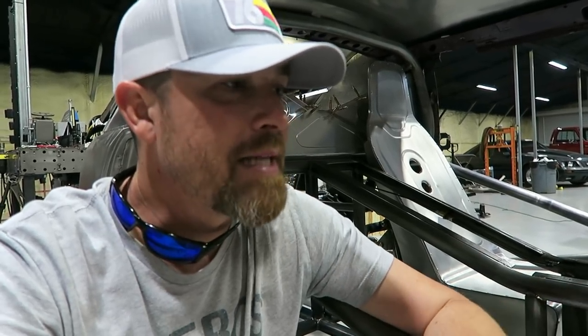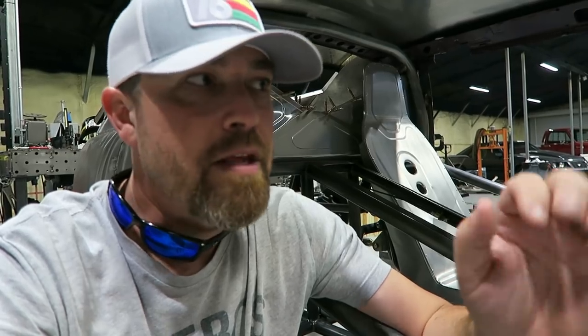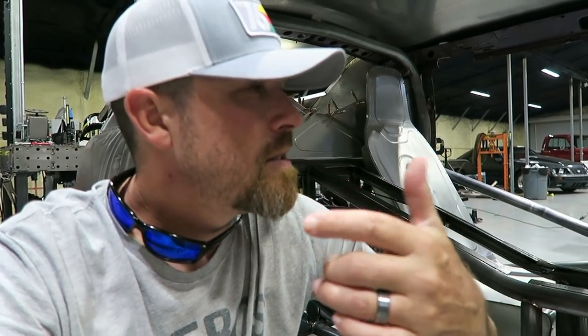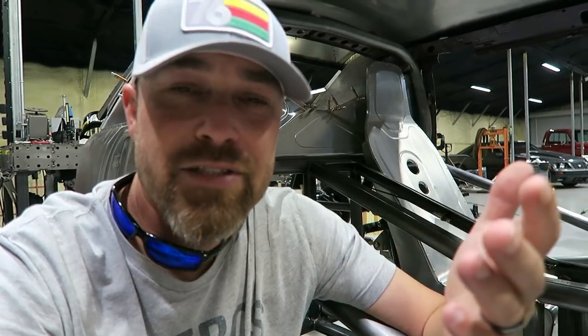So that's typically how these are wired when you buy them. Instructions are pretty simple. It'll kind of lay everything out for you. But what I use it for is, you got powers going in, they go through the fuse, and then you got power coming out to whatever it is you want to run, a fan, a water pump, a computer, your ignition coil power. Maybe your dash, your lights, stuff like that.